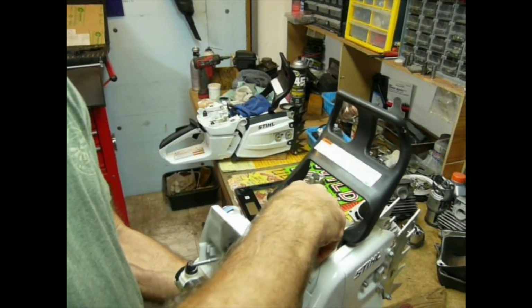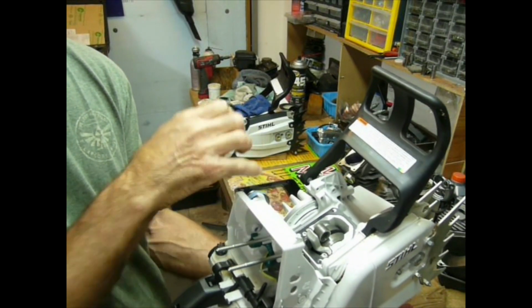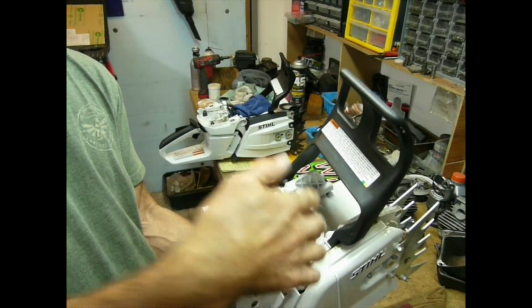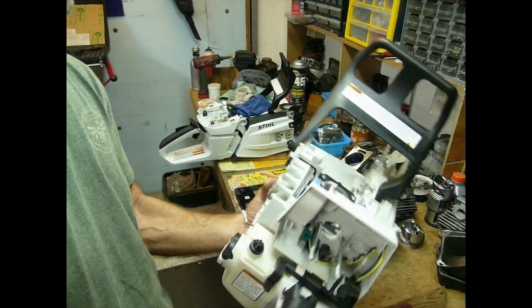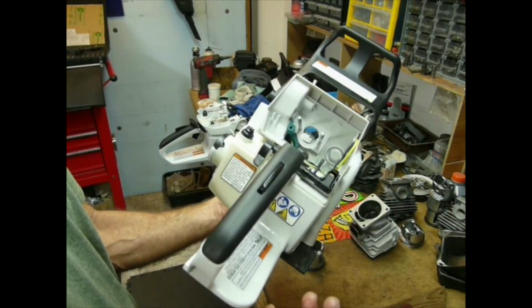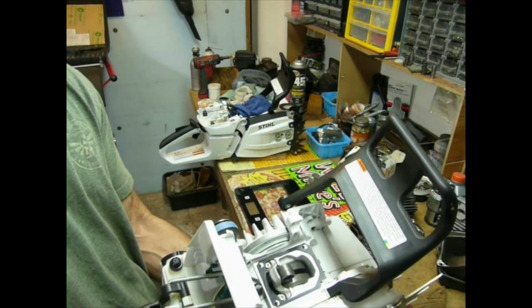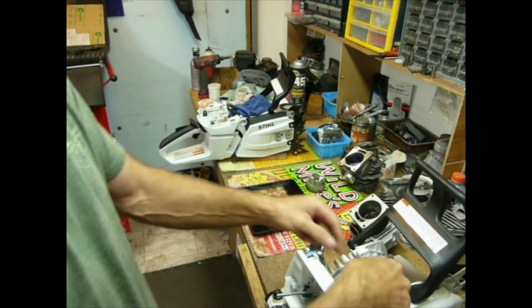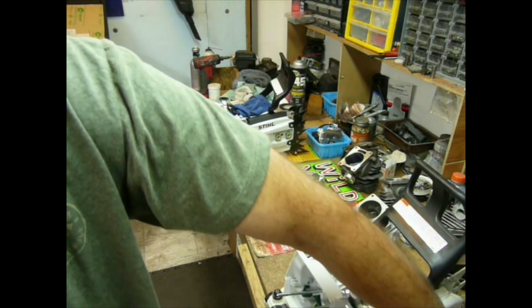They're using a little piece of aluminum that's bolted in here for stuffing the air underneath the piston out toward the front, since here's the start of the transfer port circuit. Standard poly flywheel that's on like the 460. Conceptually, they changed this design a little bit from the 460, but not too much. One thing we'll notice is it's got a pretty small wrist pin bearing.